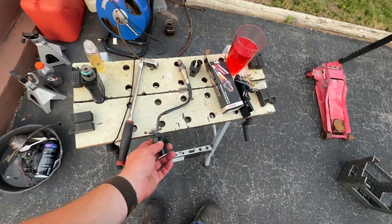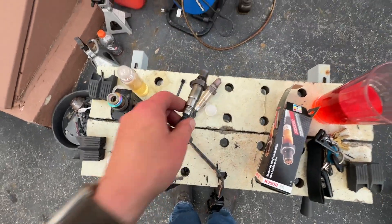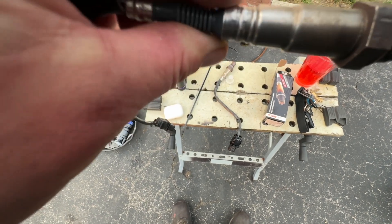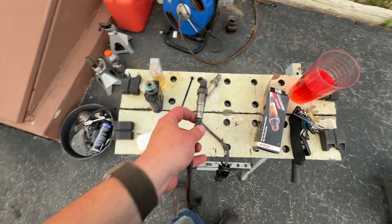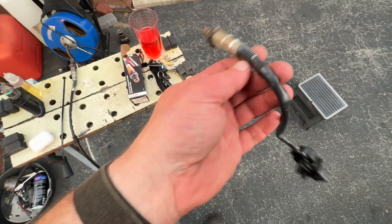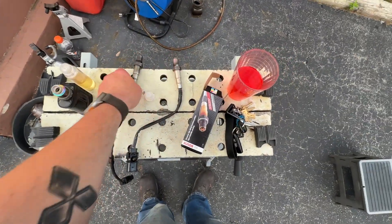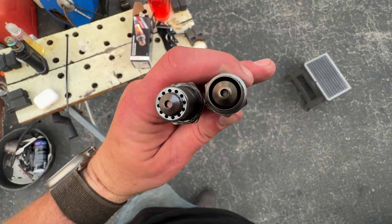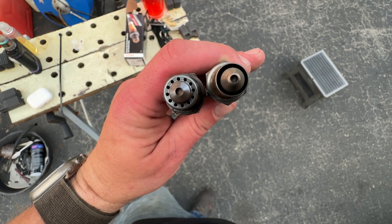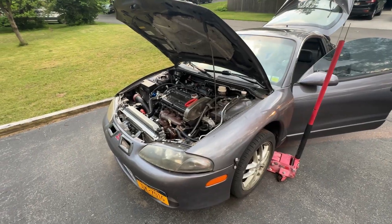This is the one I just bought; this is the one that came with the AEM Series X wideband kit. The sensors look darn near the same. I read some information that some people are getting generics from Summit and RockAuto — what you're looking for is something with serial numbers and 'Bosch LSU 4.9' on the side if it's a genuine Bosch part. Here's the comparison: the older one on the left has a bunch of holes, the new one on the right is open on the outside. The plugs are the same — six pins, same shape, just slightly different in length.